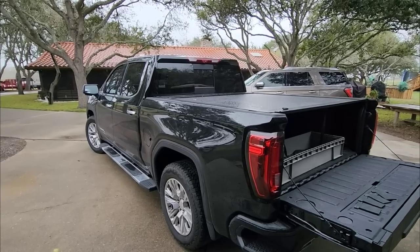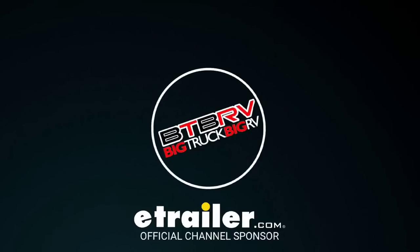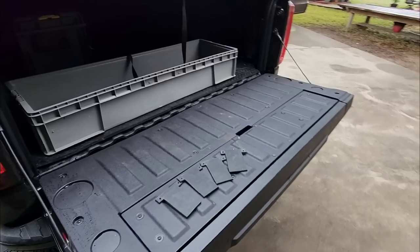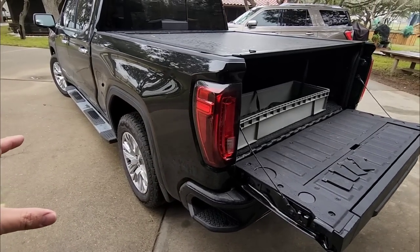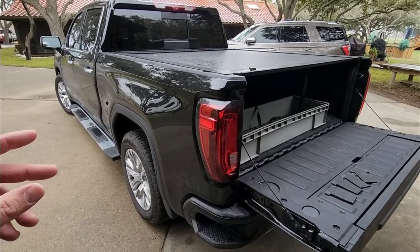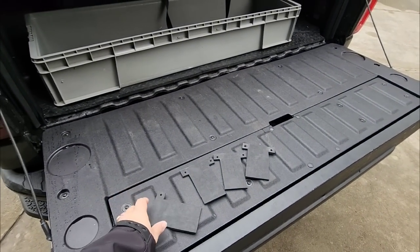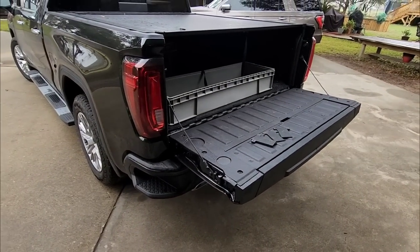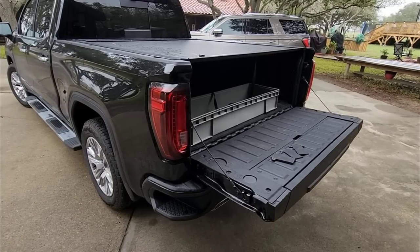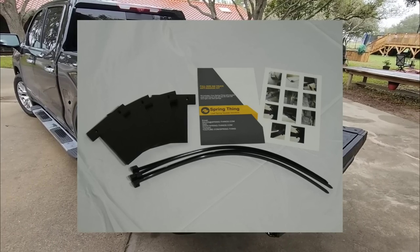In the comment section, some folks mentioned a solution that's sitting on the back of my tailgate right here. There's a product on the market that looks identical to these and is designed to eliminate that popping sound. It's essentially a rubber bushing that fits between the top two leaves and helps with the binding process. But these were actually sent to me by a viewer who made his own. He used quarter inch thick rubber with some holes on the end. The product is about 45 to 50 bucks, and I'll put a link to it in the description.